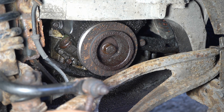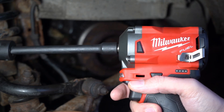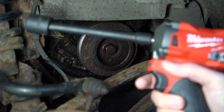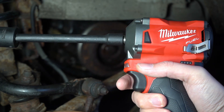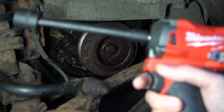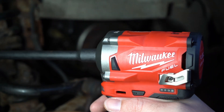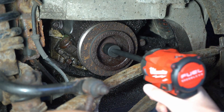The bolt itself takes a 22mm socket, and I have been using impact-rated things on the stubby so as not to damage the quite rusty bolt - my worry is that it gets rounded off. Because it's on extensions it is going to be robbing some torque from the tool, however it should still have been more than enough to break it away. I don't know when this last had a cam belt change or any kind of service - I've got no history of the car - so this might just be seized in there. With the stubby going straight in at level three, just to give you some idea of what goes on when we try to take it off...